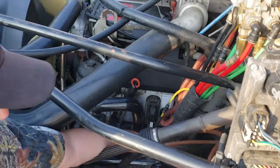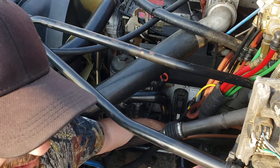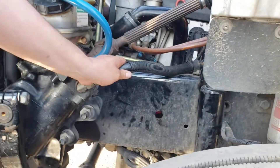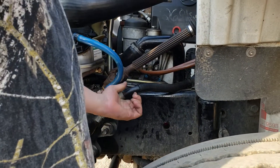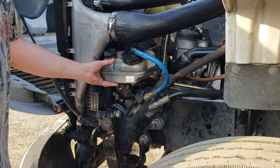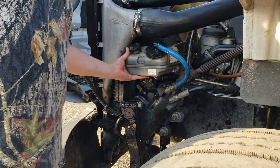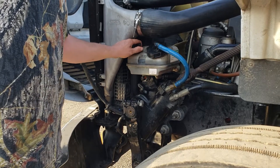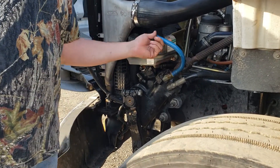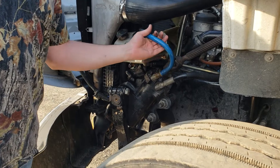My power steering pump is also mounted behind the frame and to the motor. It is gear driven, not bent, broken or damaged, not leaking, and properly mounted with no missing hardware. The power steering pump line is properly mounted at both ends with no abrasions, bulges, cuts or damage and is not leaking. My power steering reservoir is filled to the proper operating level. It is not cracked, chipped, broken or leaking. My power steering reservoir cap is on tight, not cracked, chipped, broken, leaking or missing. The power steering reservoir hose is properly mounted at both ends — clamp is not bent, broken or missing — and the hose has no leaks, abrasions, bulges, cuts or damage.